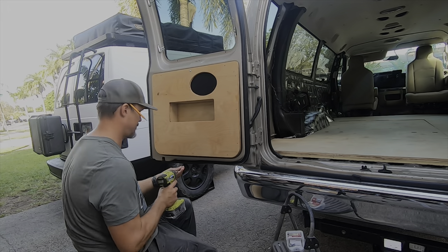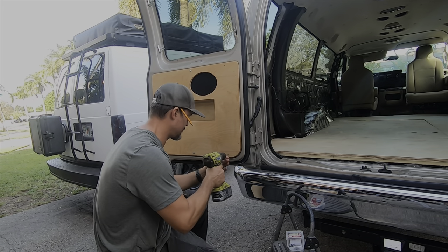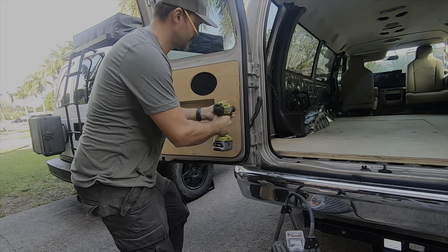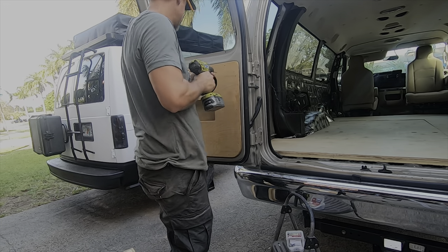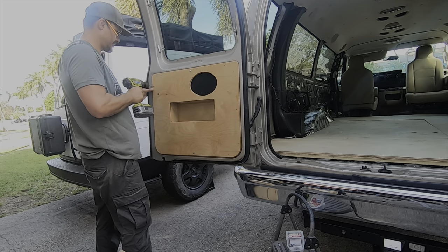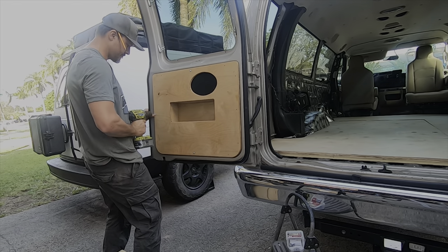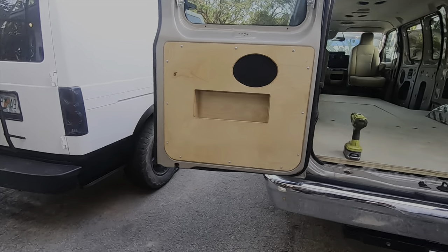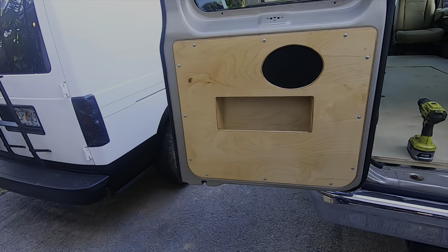You're going to pre-drill all of your holes on the door panel in your shop, then put two self-tapping screws to hold the panel onto the door, drill out the rest of your holes, and then use your stainless steel self-tapping screws to hold the panel onto the door itself. It'll give it a clean look and be very secure and look uniform because you've already spaced out all of your screws. Here you can see the inside of the pocket — and the door is done.